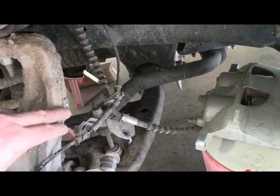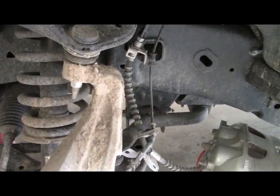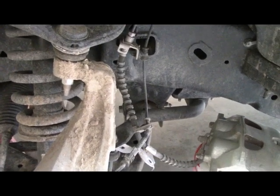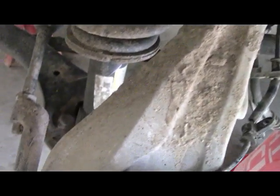There are a couple bolts that hold the bracket on — you can see about right in here. I took those off to get a little more slack. The next thing I'm going to do is take this bolt off here — the nut off the bolt for the upper control arm. That'll allow the whole rotor assembly to swing freely. Then I'll go underneath; there are two bolts on either side of the strut down there. You use an 18 millimeter wrench socket from underneath, just like up here on the control arm — also 18 millimeter.